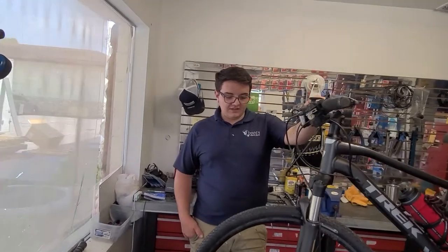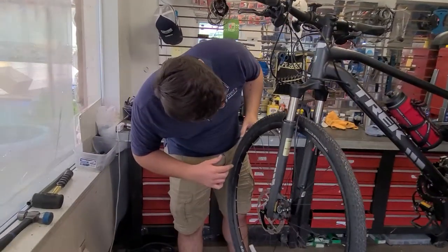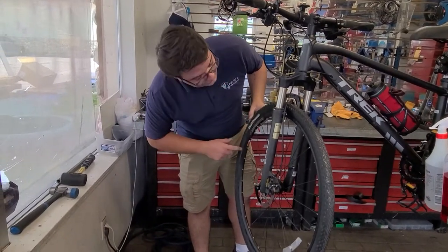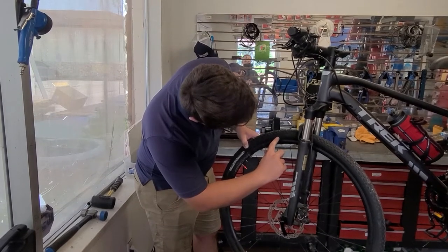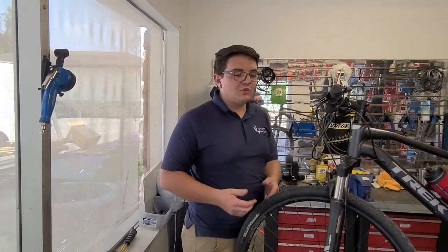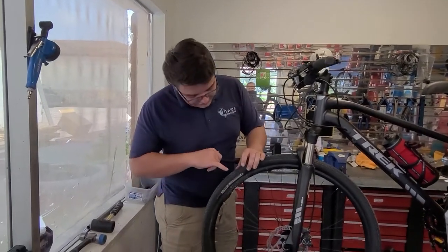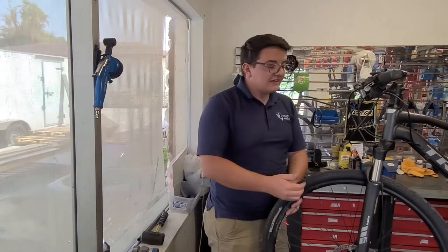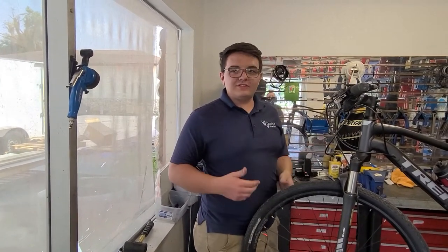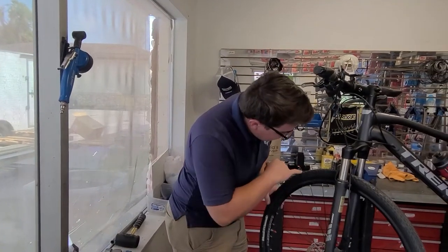Really, a couple main things that will make the bike last a long time. One, of course, keeping an eye on your tire pressure. On the side wall of every tire it'll have a size for if you ever have to replace your tire or need an inner tube, and you also have your pressure range. It'll usually say something like inflate to — this says inflate to 50 to 80 PSI. Low range of 50 PSI if you want a more comfortable ride with less bumps, or 80 PSI if you want a fast rolling ride that'll be easier to pedal. Also check for cracks on the side wall or in the treads. If you have any visible cracking, or if the tire's more than four or five years old, it's usually good practice to replace them. But these look like they're in great shape — I don't see any cracks or any sort of damage to the tire.